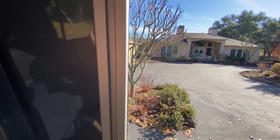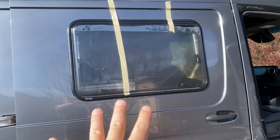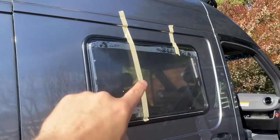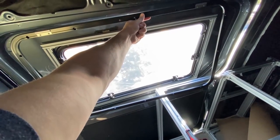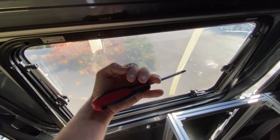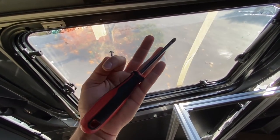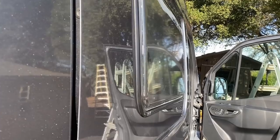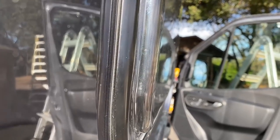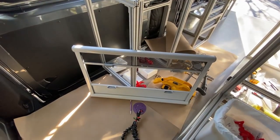It is now time for the final step — actually mounting the window. We picked up the outside portion and placed it in there, held with masking tape. Then we place the inner frame inside the outer frame as they were in the box, and go around the whole outside with the screws that came with the window. Very important: use a screwdriver, not an impact wrench. Don't over-tighten — you want the gasket to be about 50% compressed. Add some Loctite to each bolt.